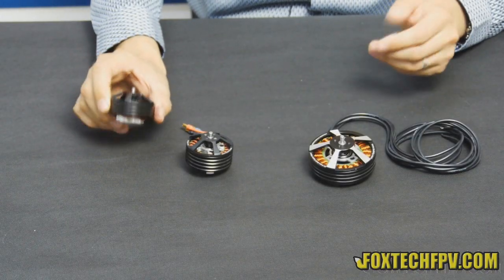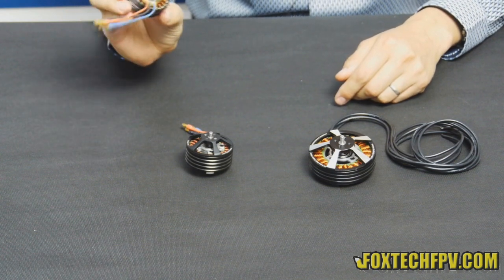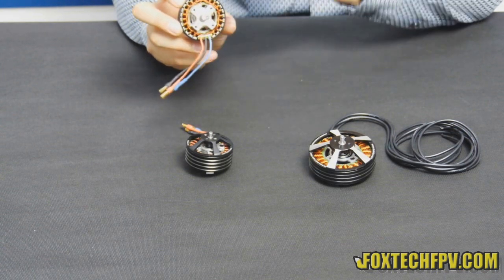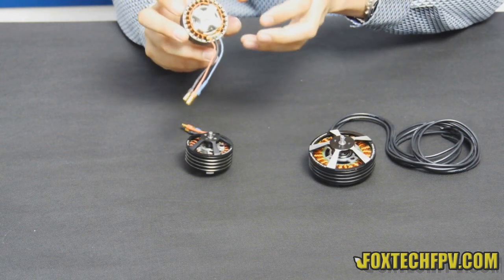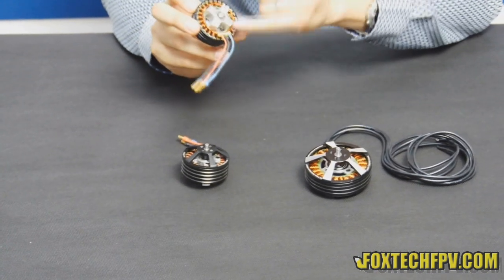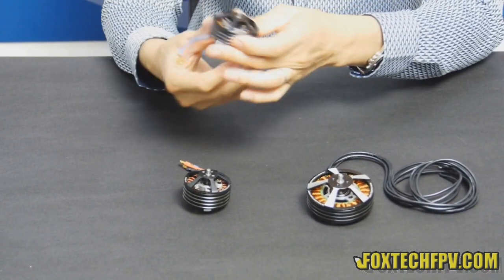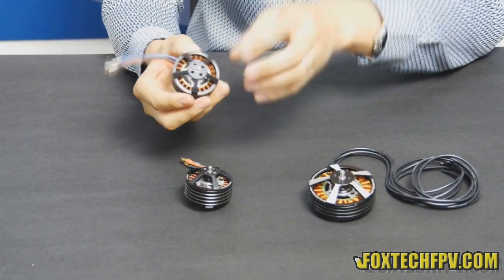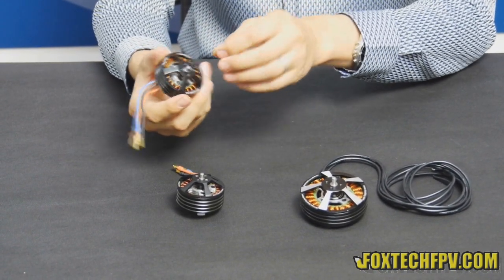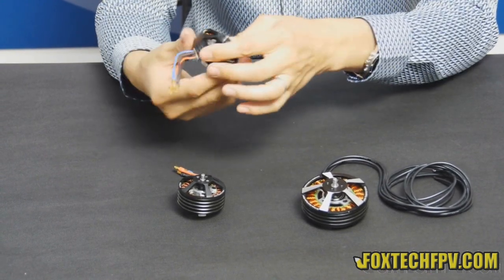DualSky really makes very nice motors as we know. If you take a look at this motor from the tail, you can see the center part is made of a whole piece of aluminum and it has 28 poles, which means very nice, very high efficiency. Although it's labeled as a 5010 motor, it's actually a little bit smaller than a 58 motor, but it has higher efficiency for its size.